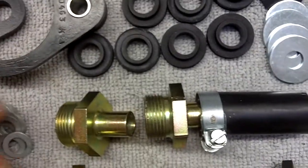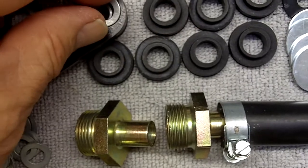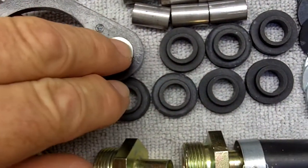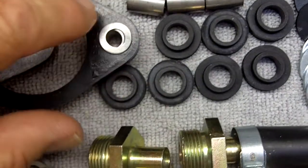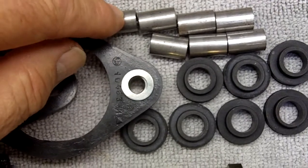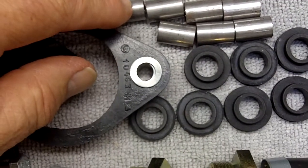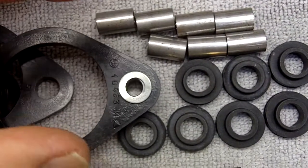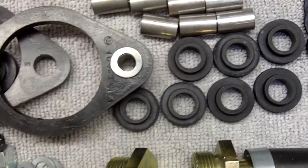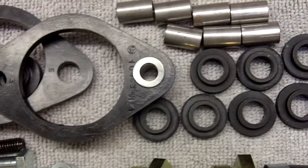You will then also use these wave washers right here. The carburetors are going to mount against here and this wave washer acts like a limit stop to keep the metal sleeve from digging into the base of the carburetor, but also it tells you when to stop tightening the bolts so that the carburetors have the exact right amount of compression and are secured with the right amount of force and torque.